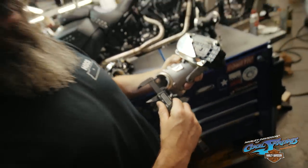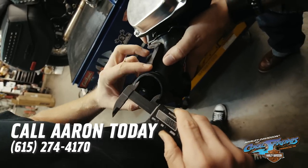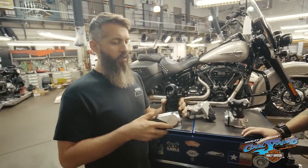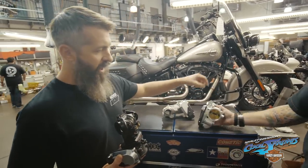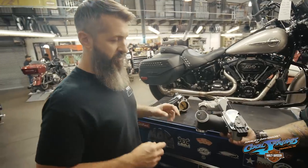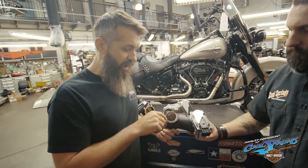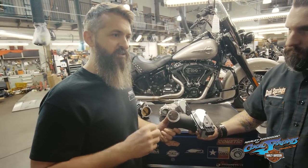We can order this in a 62 millimeter in that size so that we can port match into the cylinder heads depending on the application — that's another nice thing that HPI does. The HPI measures one inch 80, and the factory also measures one inch 80. The reason both of these are 180 is where they mount to the head, which is duplicated inside the head, whether we're going with a stock Harley M8 head or a Stage 4 head. When we do the HPI, depending on what head you're running and whether you've ported it — Branch has opened it up to actually accept the 190, so it flows right into it. Branch is porting this so it's completely smooth, opened up a little bit more, and he's claiming his flow numbers have spiked.